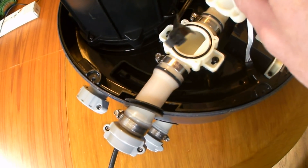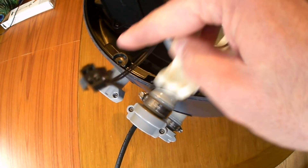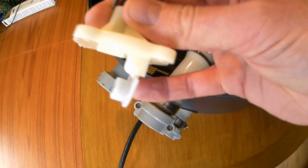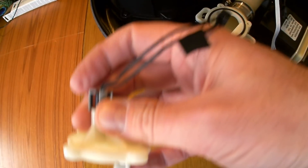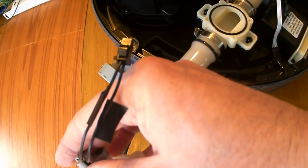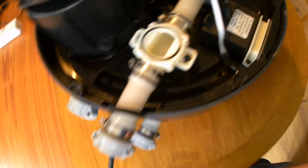The way to test it is to put a meter down those two holes there. It should be in the one that's normally open — there will be no resistance. When you close it, you will see that there is a resistance on that. Also a good thing to do: have a look — is there any hair and stuff stuck in there? There probably isn't.